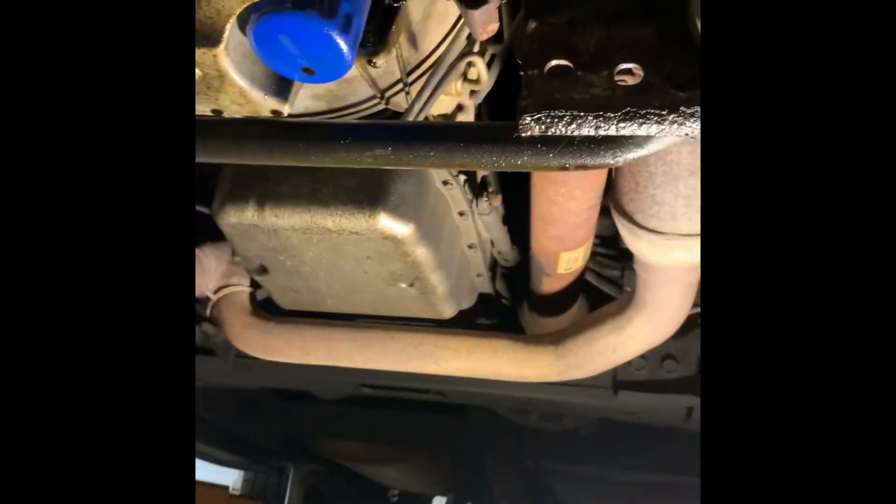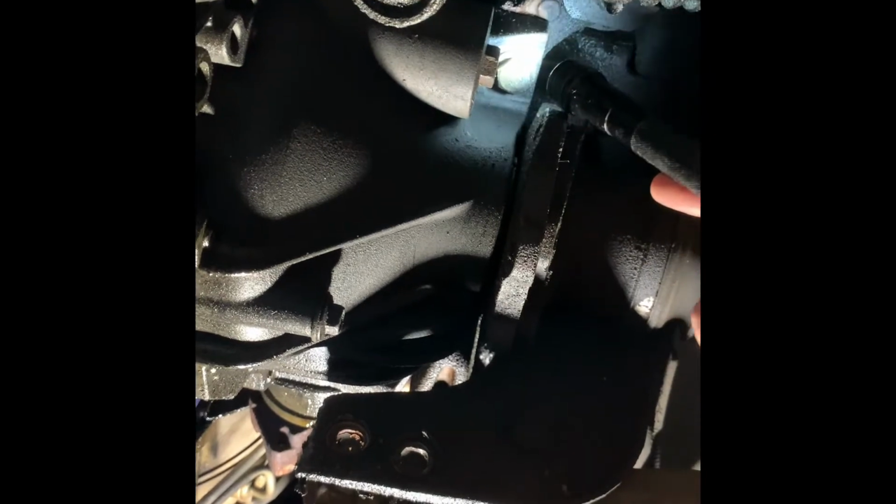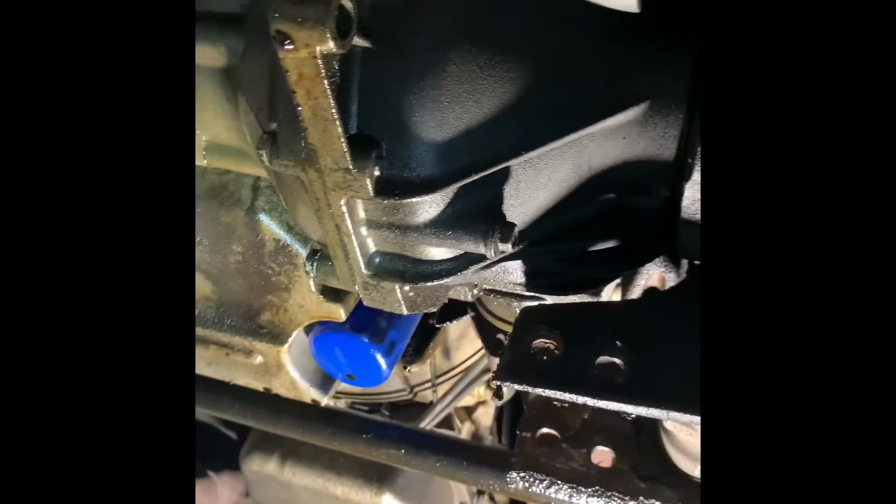So looks like there's 4 main bolts or nuts that hold this carrier up to the frame. There's some bushings and stuff. So I'm gonna try taking the actual big bolts out first. Might have to take the actual diff from the bracket itself. There's just 2 bolts on each side on this one. Passenger side doesn't have that option. So actually, I think I'm just gonna take those 2 bolts that hold it to the bracket out. Save trying to slide it away from the stud. But I'll get you an update on exactly what it is and what size, all that stuff, here in a second. But so far, this is actually a heck of a lot easier than I was expecting it to be.